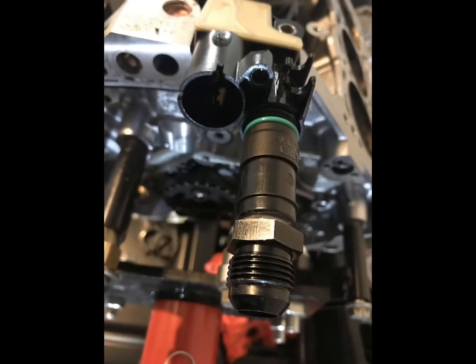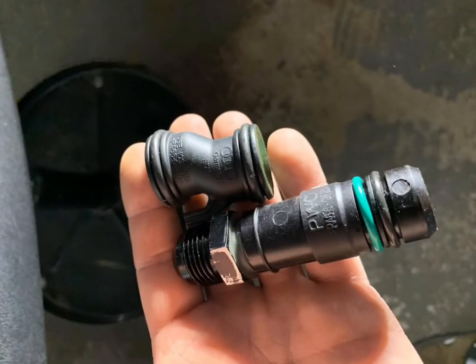This is the location of the plugged piece. It's in the right corner of this picture, and on the left side is your spider hose which connects to your valve covers and goes to the PCV system. You have to pull out that piece in the right corner, make a hole, and add the JB Weld fitting. Then put it back in and you're all set.